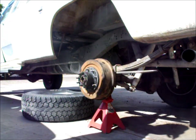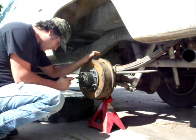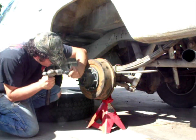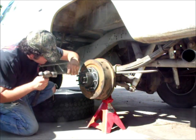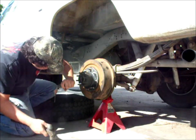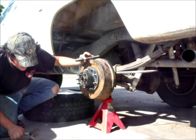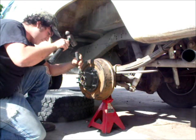Next, what you're going to go ahead and want to do is remove your hub nuts. I'll show you in a second what holds the hub on. They do make a special socket to remove these but I don't own one, so that's the old redneck way - with a hammer and a screwdriver. There's a retainer behind the first hub nut, it's got these tabs on her. Keep your outer nut and back it on there - and it's on. Now I'm using the old redneck method which involves a screwdriver and a hammer to remove this, and it seems to work.